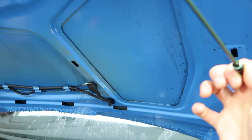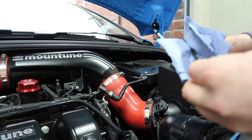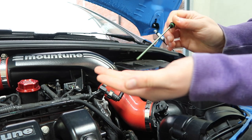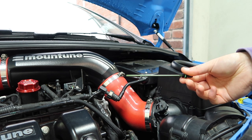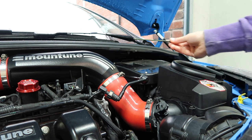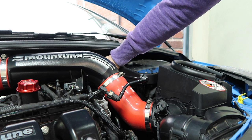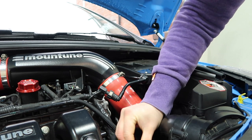There's hopefully just a tiny little dot of oil on the bottom of the stick, but not actually very much. The correct thing to do is to wipe it off and dip it back in. Yeah, there's basically nothing on this. I did notice this back when, even a couple of months after I installed it — I installed the CCV side closer to the start of the year — and really it doesn't seem to be catching a whole lot. The tiny little dot in the bottom is kind of it. It's catching something, but very very little over a very long and extended period of time.